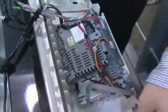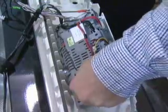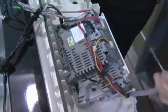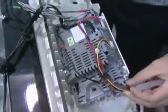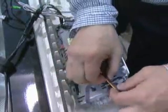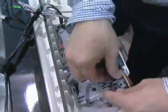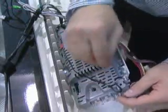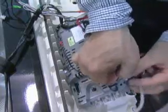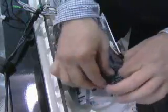To remove the machine, motor control, and pressure transducer, pull the pressure transducer tube off of the fitting on the control. Disconnect the 9 wire connectors from the control and disconnect the power supply cord connector from the machine control. Then disconnect the wires from the retaining clips.